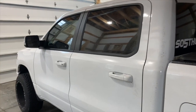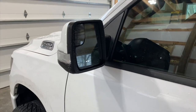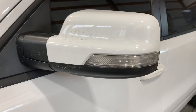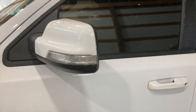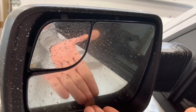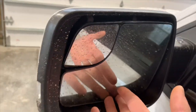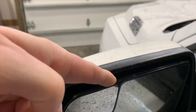It's like two days later and I'm in the process of editing this video. I did a quick search on YouTube and never really saw an informative video on how to actually replace the outer mirror cover. So real quick — the first step you're going to want to do is take your mirror and tilt it all the way down like this. With it all the way down, you're essentially trying to get a screwdriver through this gap here and get down to the tabs.